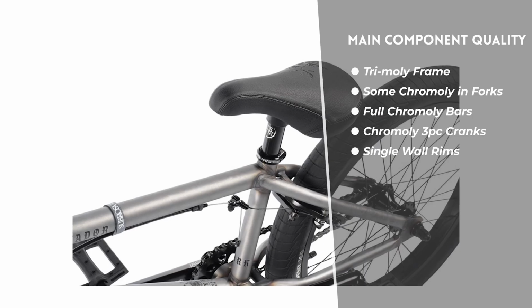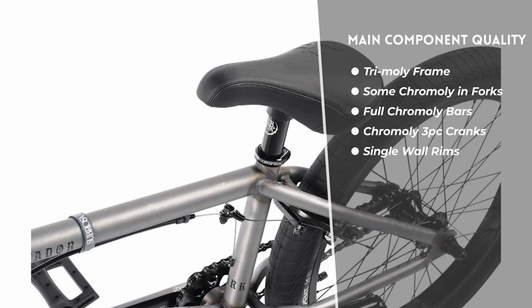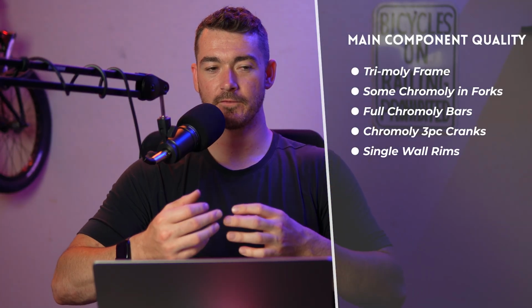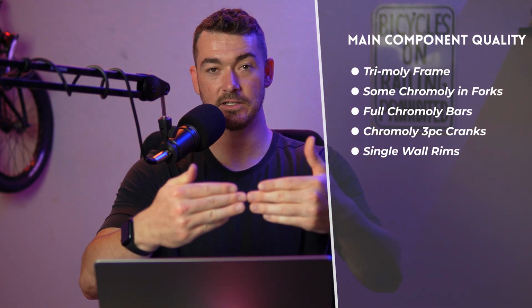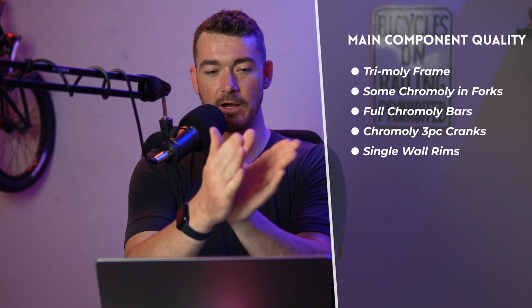You got to think about it. When you're doing spins, your wheels are trying to move the way that you're spinning, and the frame's the only thing holding them and keeping them from flexing. And when you have a weak frame, especially the back end, it's going to flex there where the high tensile steel welds onto the chromoly, causing your back end to tweak out like this.